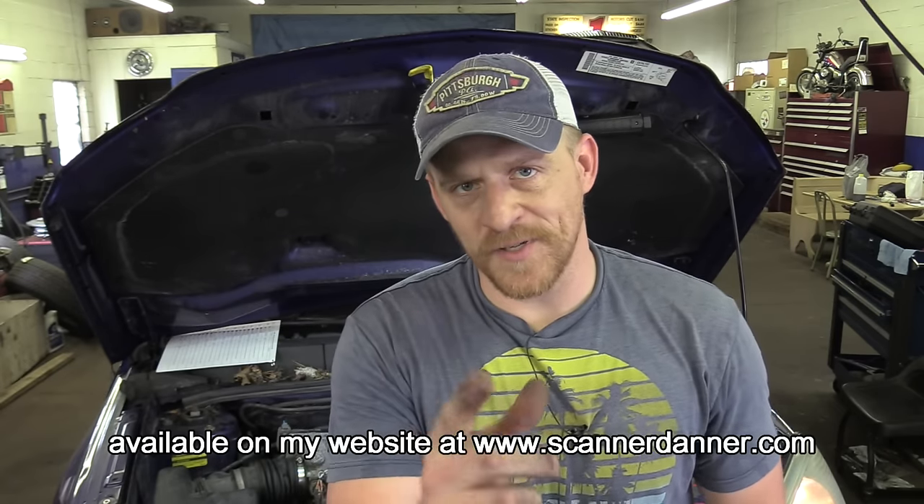That's what we want to hear. Well guys, that was a nice simple one. Pete, nice job following directions over the phone. Open circuit, control side of a relay, ground-side switch circuit. For more training on diagnostics and troubleshooting, check out Scanner Danner Premium — my classroom channel where I invite you into my classroom at Rosedale Technical College. There's a 14-day free trial with hundreds of hours of classroom lectures, including ground-side switching of a relay and driver testing for a computer — chapter three material. Hope to see you guys over there. Thanks for joining me. Open circuit. See you next time.